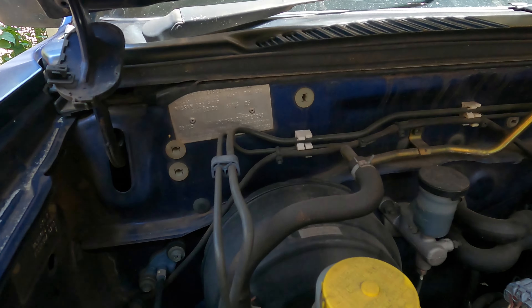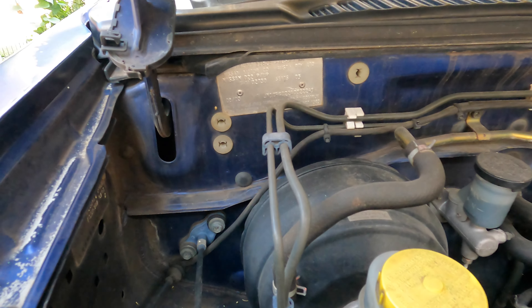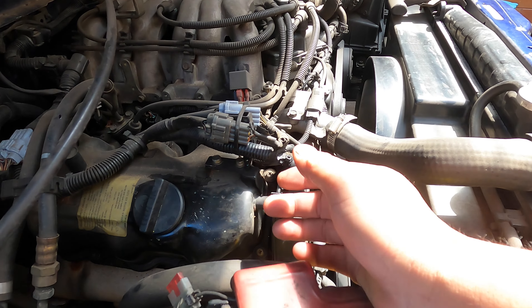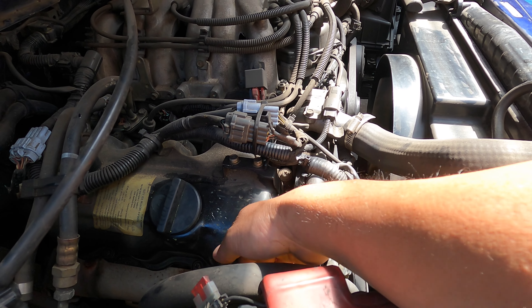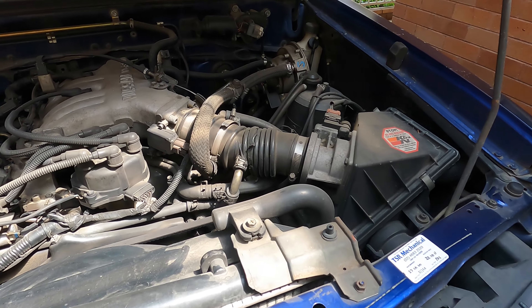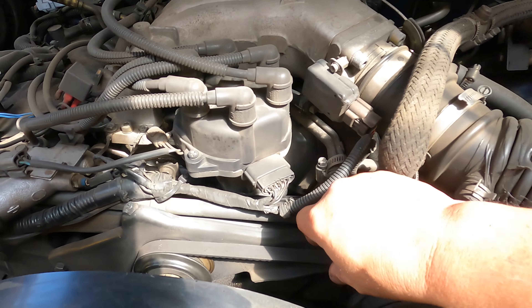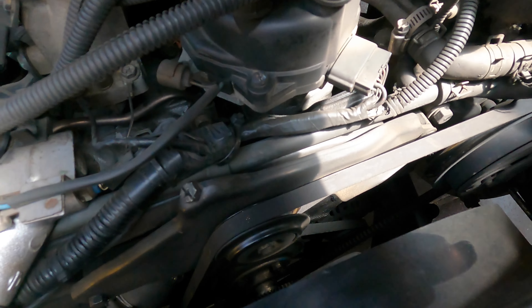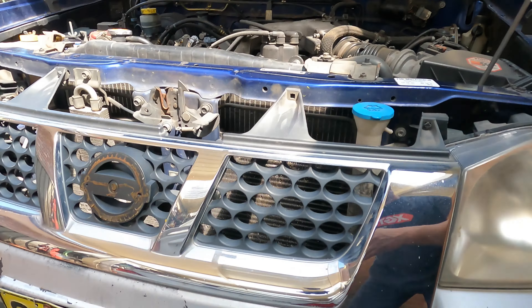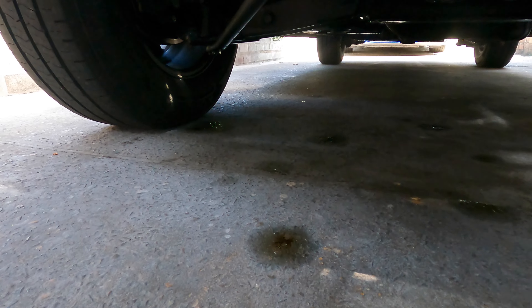So that's why countryside people could afford to buy this one instead of a more expensive car. This is a 2003 with a 3-litre V6. They brought it here for inspection for an oil leak. I checked around and found no major leaking down - just a little bit of minor leak from the rocker cover, which is not important. I checked everything and did a full service. It runs on gas, so the belts are still all right but a bit loose. There are three separate belts. The first thing we have to do is loosen all the belts and check the leak that's the main concern - there's oil dripping heavily from underneath, coming out from here.